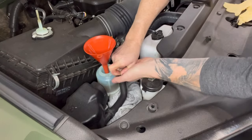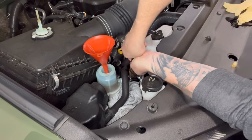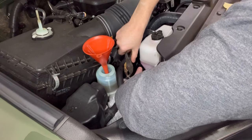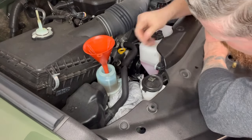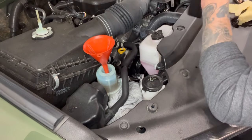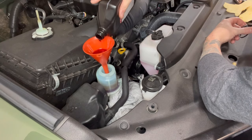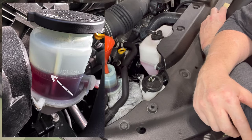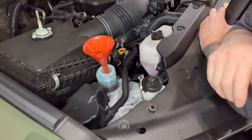As you guys can see, this is pretty easy to do and I have absolutely 100% confidence that you guys can accomplish this very easily on an afternoon. I put the clamp exactly where I found it, just the way I like to do it. And now, of course, you grab your leftover brand new fluid and fill it back up. The key here is to fill it back up based on the line to the left of the reservoir, which is the cold fill, and you want to bring it to the max. Once you've done that, I'm going to show you how to bleed it.